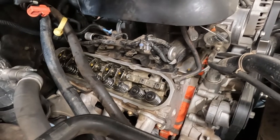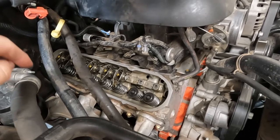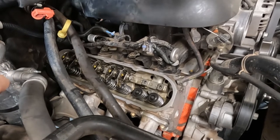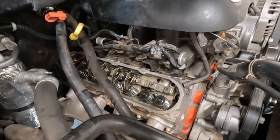I'm starting to get a lifter tick. I have Johnson 2116 LSR lifters and Manton push rods. I had to get custom push rods and I'm tearing this down to figure out which lifters have extra lash in them.